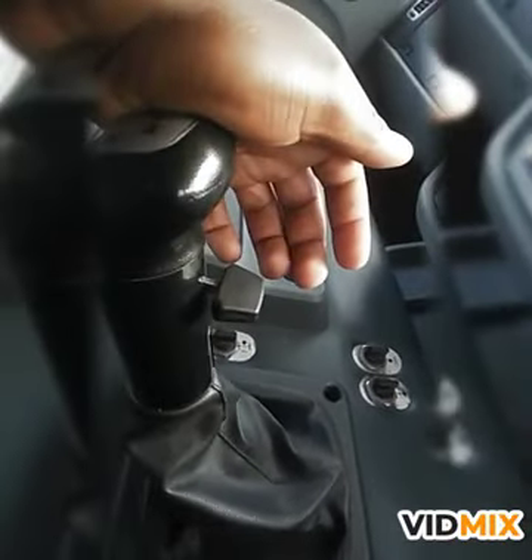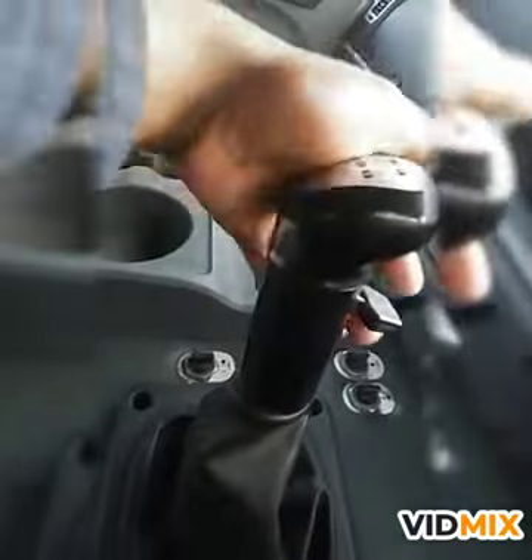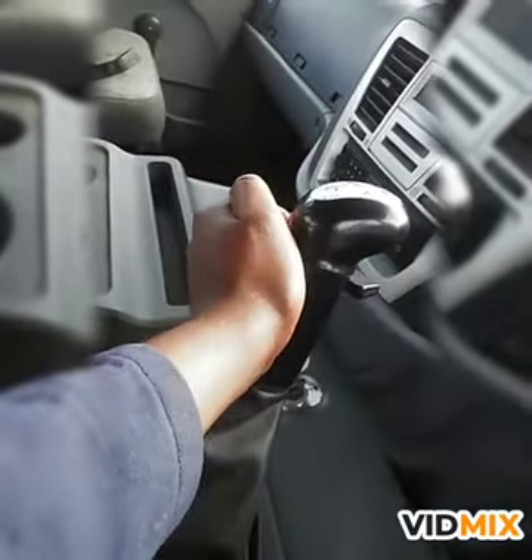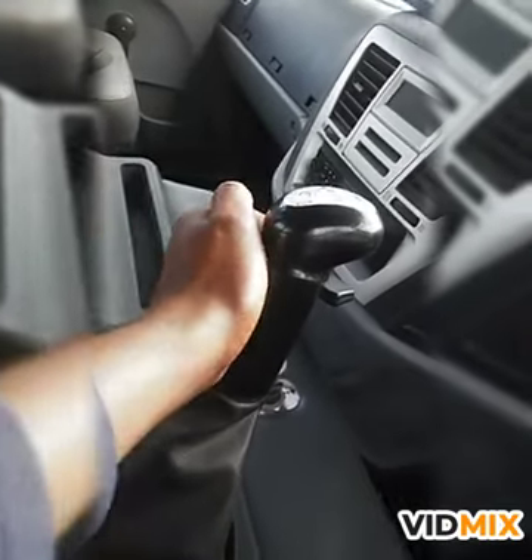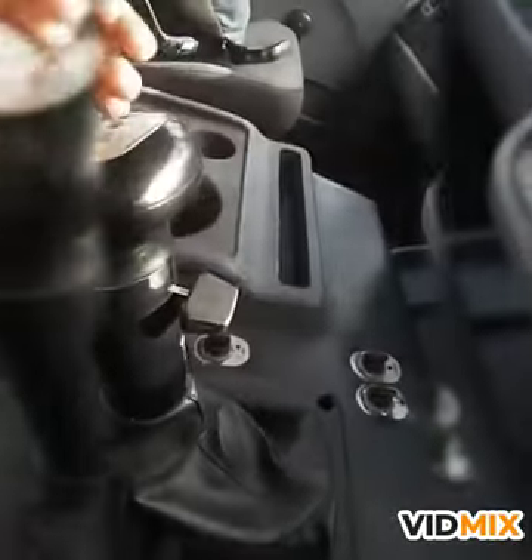So it's up to you whether you want to split on gear number 6, or when you are in gear number 6 just push it to neutral, high range, gear number 7. From gear number 7, when you want to move to gear number 6 — gear number 7, neutral, low range, gear number 6. That's 12-speed manual gearbox — low range, high range, low gears, high gears. More videos will come as time goes on, but for now please watch, subscribe, and share. Thank you.